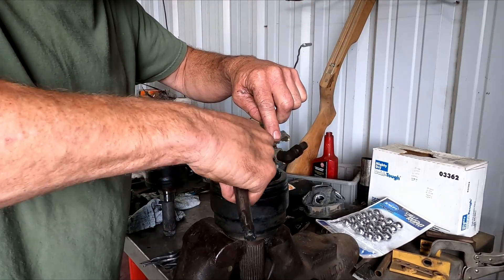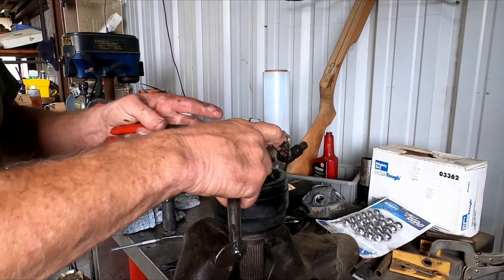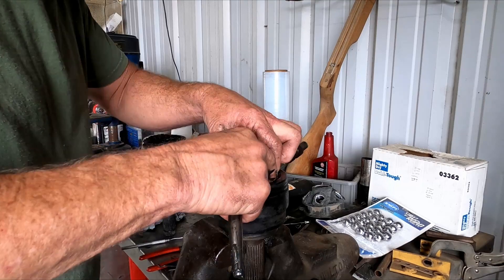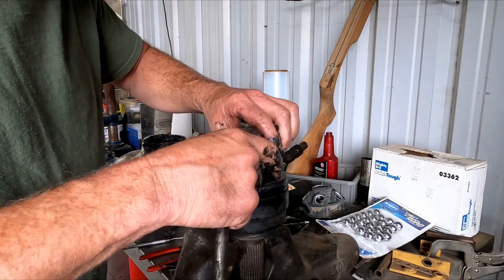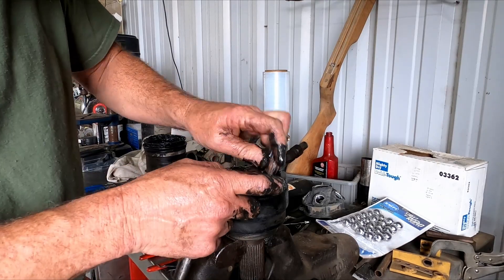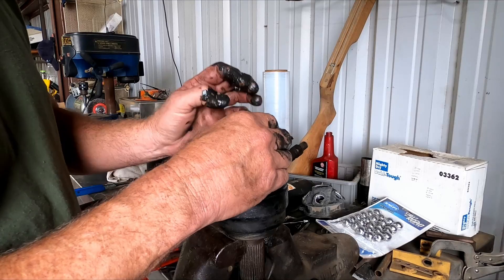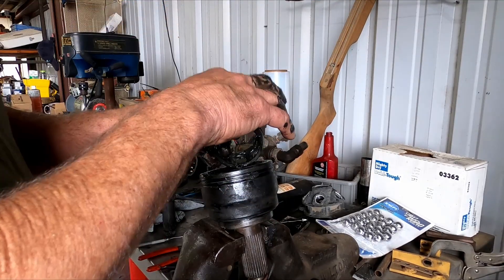You've got the race and the cage fighting each other here. Use a screwdriver to pop it out — this other ball just fell out inside. There's another one there. Push that ball out; they're sticking a little tight in this cage. Make sure you got them all. Then you just have to move it around and work it out. A bar helps a little bit — just a little bit — you don't want to chip anything, but it'll hang up and takes a little work.